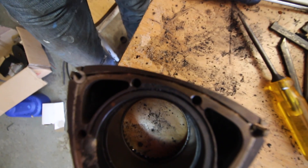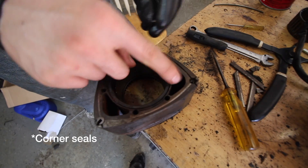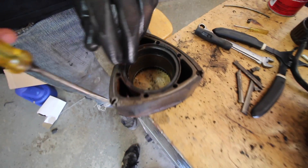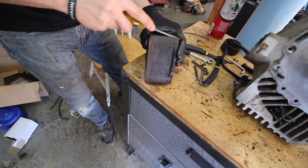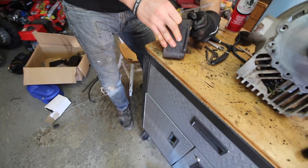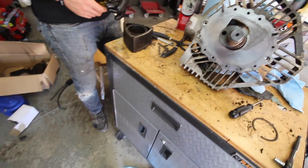Inside each holder is just a little flat spring — a bent piece of metal that pushes up on it. I freed one up and cleaned it. I do remember when I had the spark plug in and was turning it over, it did not feel like it made very good compression at all. I think the seized apex seal was the worst thing, but all of these stuck side seals would also hurt compression.